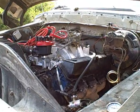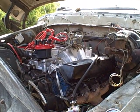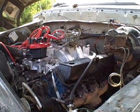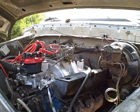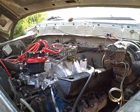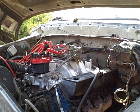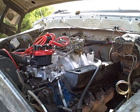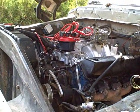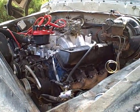Today we're going to do the EOIC method of adjusting the valves. I have compression on all but three cylinders — cylinders one, two, and three have no compression because the valves were not adjusted properly. The manual just said to unbolt everything and put it back together the way you found it and torque it down, which caused all kinds of problems. So I'll be back in a moment after I pull the valve cover.